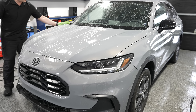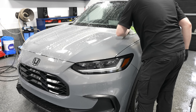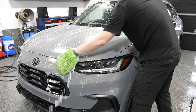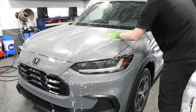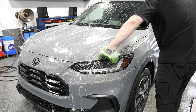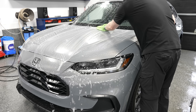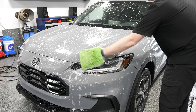Feel your paint. If it feels smooth like glass, you can skip the clay bar stage. But if it feels rough and has a lot of contamination, I highly recommend using a lubricating agent along with a clay bar, clay mitt, or clay towel to remove that embedded contamination or paint overspray — get the paint as glass smooth as possible. Then decide if your paint needs machine polishing. If you have light swirls, scratches, or oxidation, machine polishing or paint correction is the best way to improve gloss by flattening the paint and having better light reflection. Remove all defects through your polishing stages, then remove polishing oils with a paint prep or panel prep spray — you should be left with a squeaky clean surface ready to receive protection.